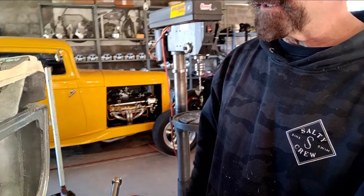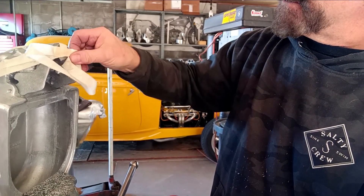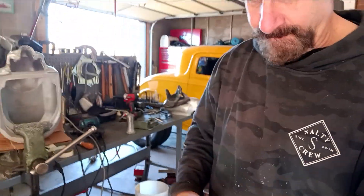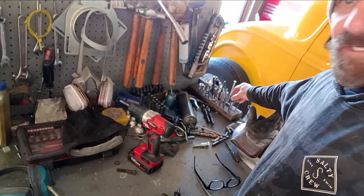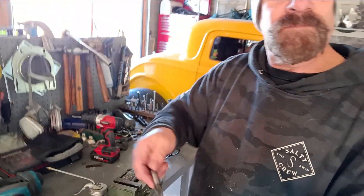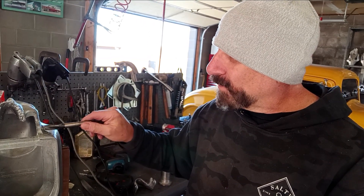After it's drilled — it's a quarter-20 drill — I take all the tape off that held it in place and just rip it off. Here's the jaw and everything. I gotta get this other bit — it's an end mill, and it actually goes into that hole with the pilot. It's got a pilot on the end that goes into the quarter-inch hole, and it cleans it up real nice. I gotta do that next. It's just me taking the video, so it's hard to hold the camera and do everything — plus I'm making the video go a lot faster, just showing you step by step. I just counter-sunk the holes — makes it real nice, cleans it up, little bolt gets in there and looks really nice.